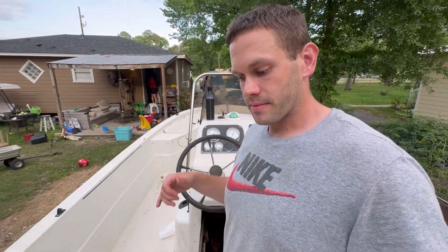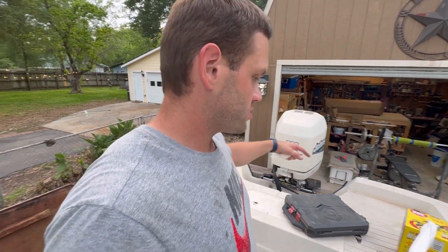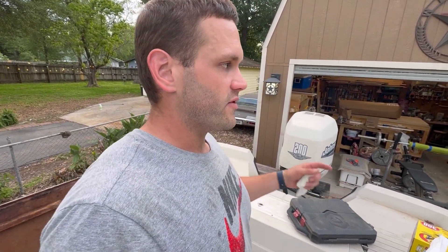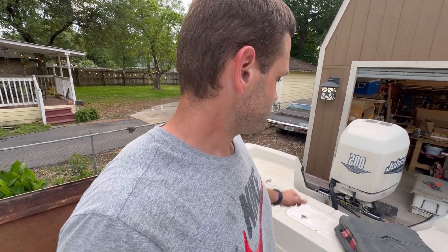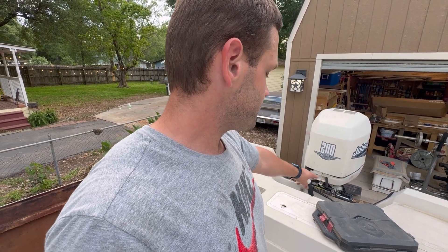That's a video on how to set up and bleed your Seastar system. As I mentioned, the old helm pump had water in it. I pulled it out and dropped the hoses out. I went back here and had my wife hold the tubes into it - there's a jug out there in the garage - and I was manually pushing the motor back and forth to clear out junk in the lines. We replaced the seals and got a lot of junk out of there. There was a lot of water in there too, so I pulled that out.